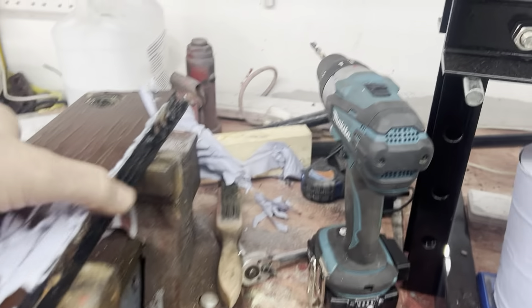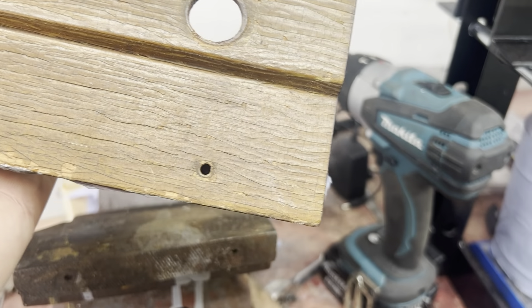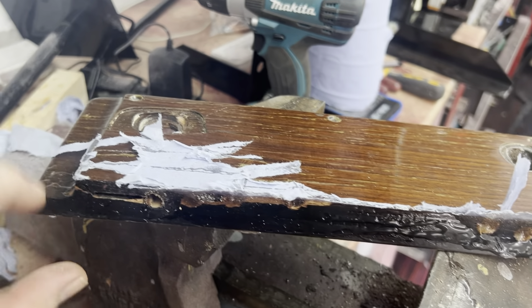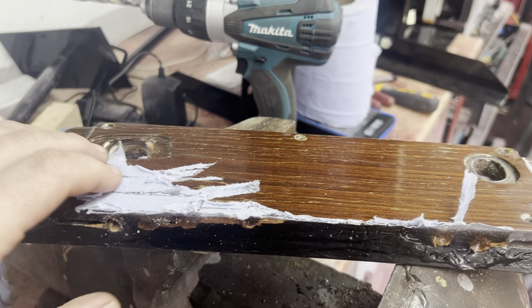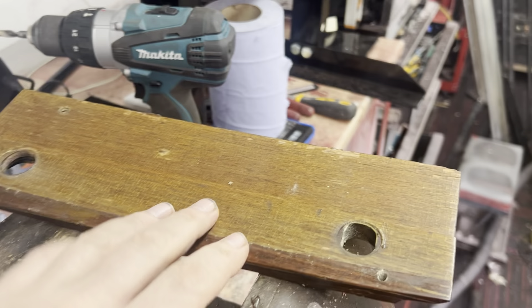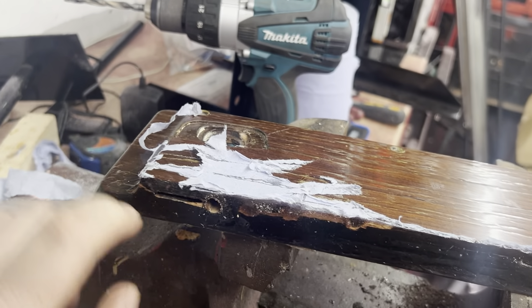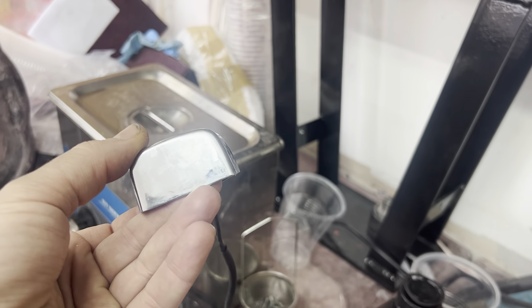Now the glove box was broken - the front of it had a screw holding the hinge in place. Last night what I've done is clamped it in the vice and epoxy resined the pieces together, so I just need to sand all that down and it'll be ready for re-veneering. I need to make sure it's worked. That hole there is for the glove box light - the glove box light is here. I've had it in the sonic cleaner and it's come out like brand new, even where the cables sit inside.